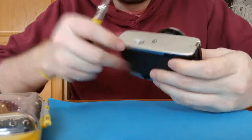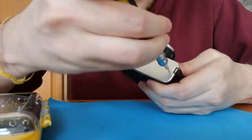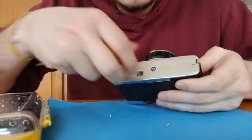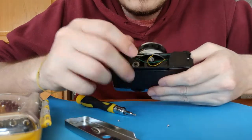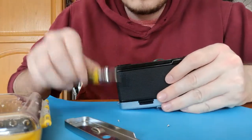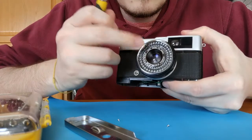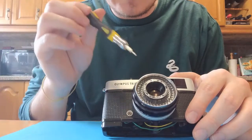What we need to do here is unscrew these two screws. Once you've taken those two screws out, these wires need to come up over this. You need to pull those wires up — they can be a bit tricky. Once you've done it once it's pretty straightforward, and then you're ready to take the lens off.